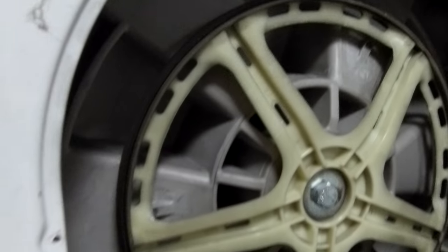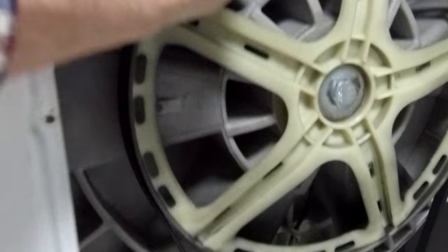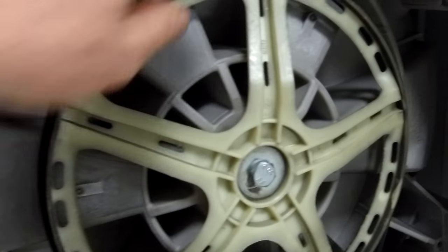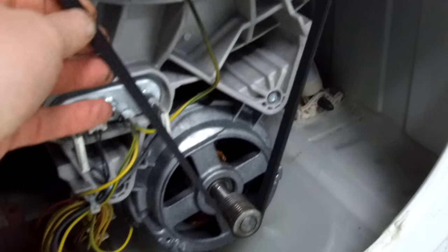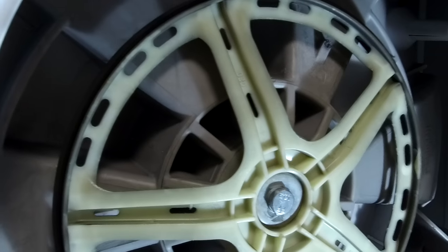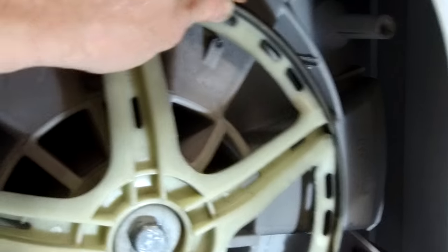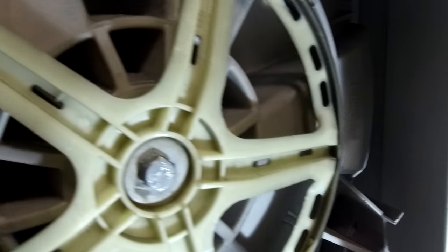So we've got a motor down the bottom here — we've got the motor, that's all wobbling about. Now apparently we've got to undo that big nut there. We've got the belt, so if you have to change a belt that would be an easy change. What size is that? Get the socket set — looks like about a 17 or something. I expect the belt is probably a bit more stressed, but you can inspect the belt, have a look if it's got any signs of wear on it. Apparently you get water leaking down the back of the bearing.